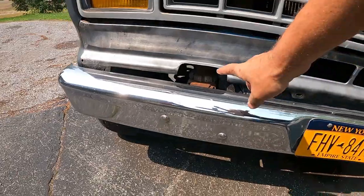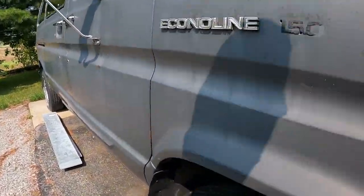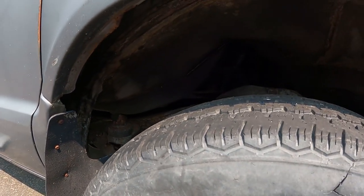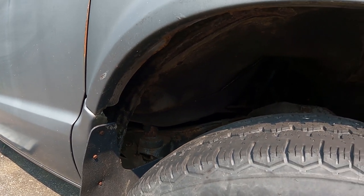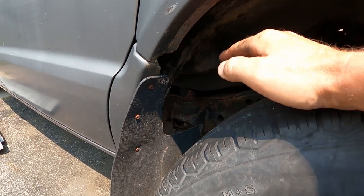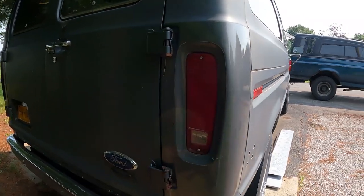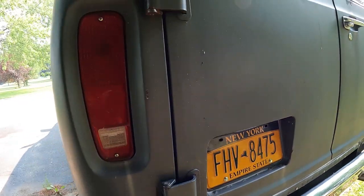But as you can see, this van has a 3-inch body lift. If I come out here on the side, you'll see it better. See these 3-inch blocks here to accommodate that raised floor section. They pick the whole body up 3 inches, so I will need to unbolt the entire body, jack it up, and remove these blocks here, and then set it back down on the factory mounts. So all in all, that was a good score for the old Quick Speed Shop buggy van build here.